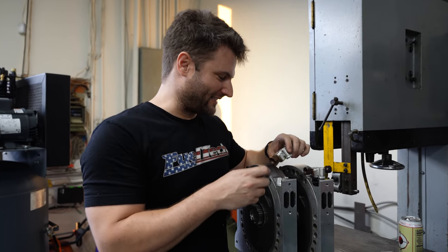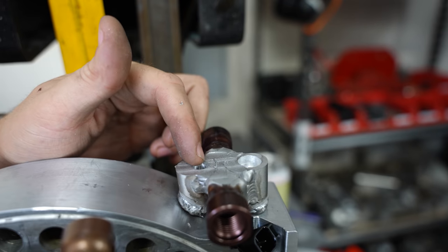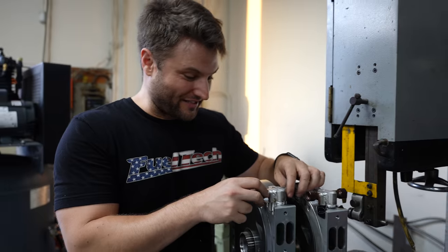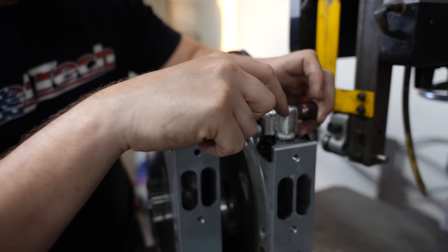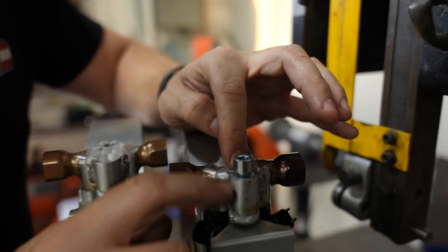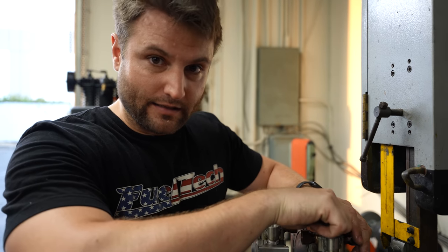We are on the tail end of this. They're ugly as hell, but they work until I poked through on this one — I poked into the fuel rail itself, so that's absolutely not good. It shows you how close that is. I'm going to have to make my own. This was excellent for making sure we get the right heights, lengths, and that it clears the intake manifold. We'll do a nice, heavy chamfer on here. This one actually goes in perfectly — it's squared, countersunk all the way down to the correct height, using an end mill instead of a drill bit so it's got a flat bottom. We'll just measure, model this, make the small adjustments, and cut my own.